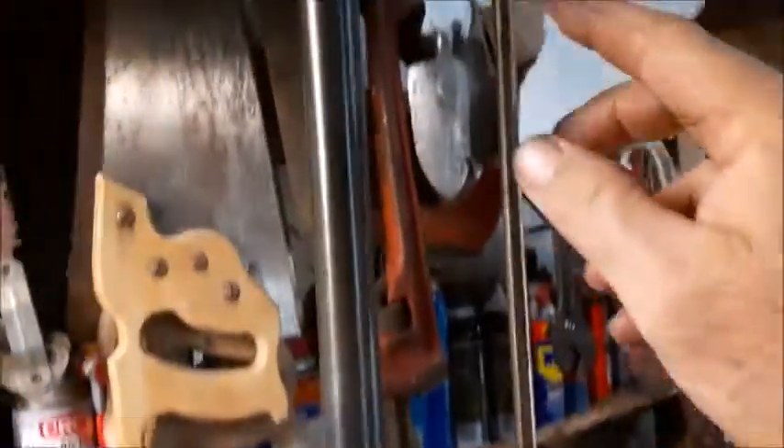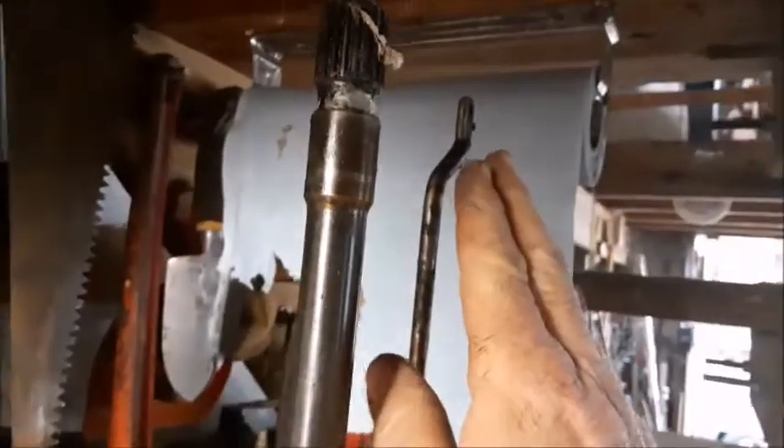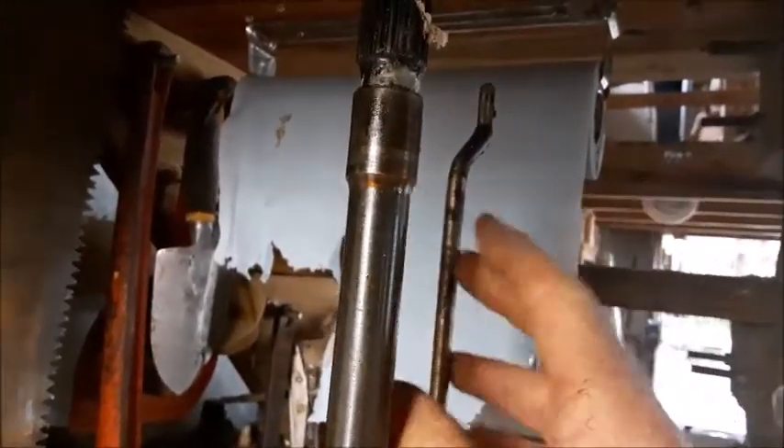When you look at how it came out, you can see how this thing twists and swings over to the right side of the motor. This shaft is actually threaded into the unit. Be sure not to twist the shaft because it's threaded into the bottom of the lower unit, and the height adjustment depends on the number of times it's rotated. So leave it exactly the way it came out of the motor.